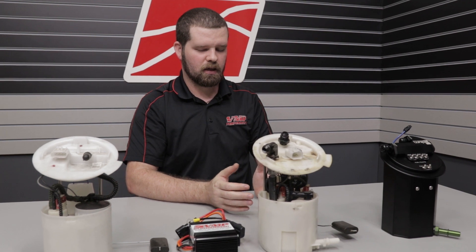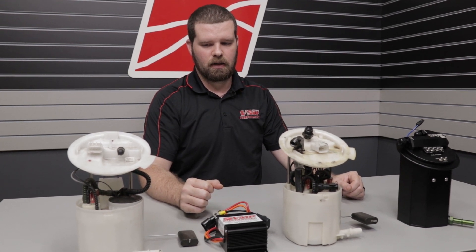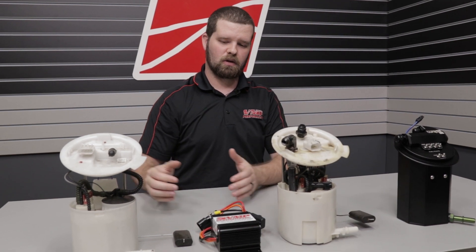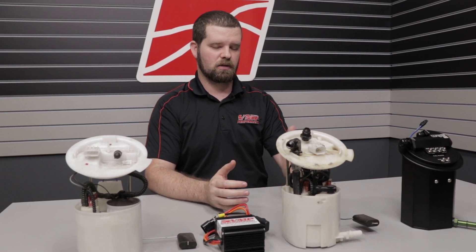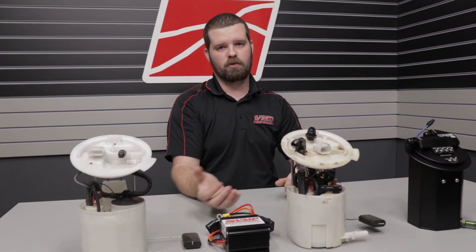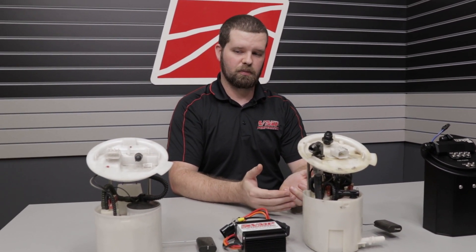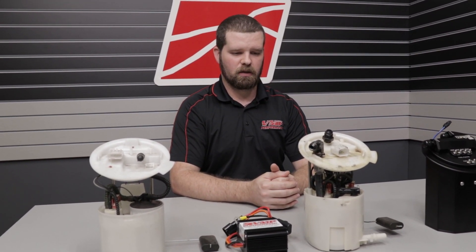This video is just meant to be a quick overview of your different options available in the marketplace. At the end of the day, what your fuel pump has to do is supply the adequate amount of pressure at a certain amount of fuel flow with a certain amount of input voltage. What that boils down to is: if you're moving a certain amount of air, you need to be moving a certain amount of fuel with that. Which setup is right for you is really going to depend on how much air you're moving — which can loosely be correlated with how much power you're making — and also which fuel you are trying to make said power with.